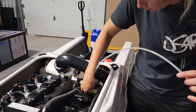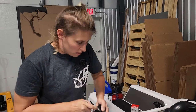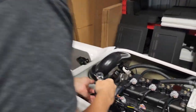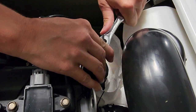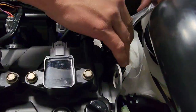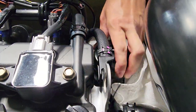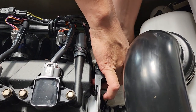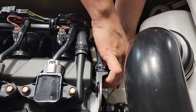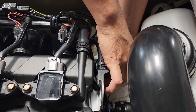Now that what oil we're going to get out is extracted, go ahead and remove the extractor. You've got your oil filter wrench here — I've got my bed of towels around it. It just needs to be snug to break free. Let's see if I can do the rest by hand — yep, just coming off there. While it is easy to get to, there is the chance that some oil can spill out, so be ready with your towels.